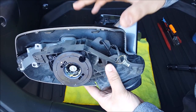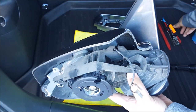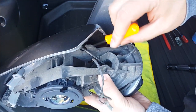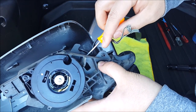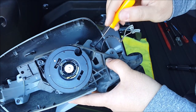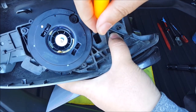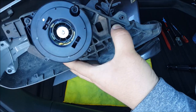The last thing that holds this back cover is a tab located in the back right here. You see there's an opening here. If you look to the back, there is a similar clip to the ones you just removed from the two sides — there's another one located back here. I'm going to put the pick in here and undo that clip.